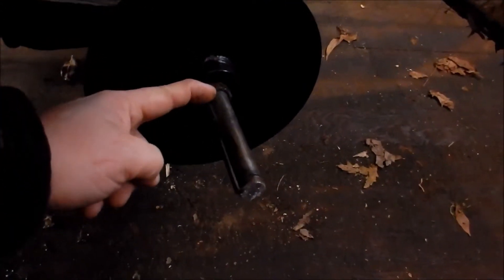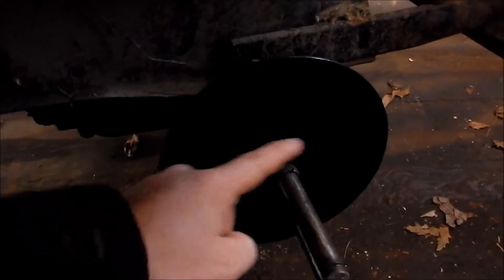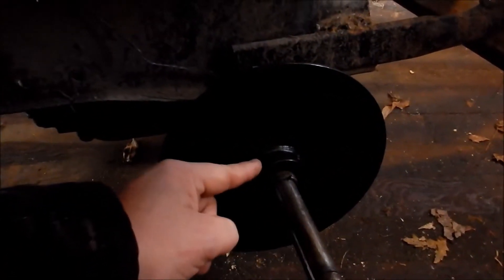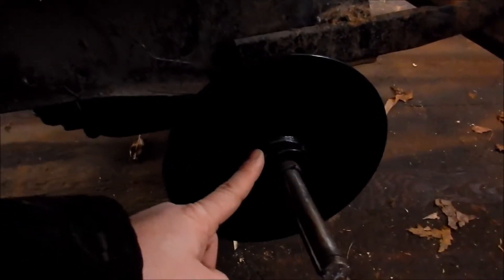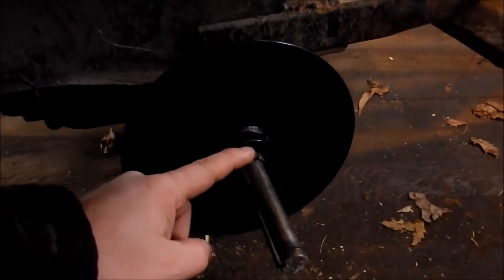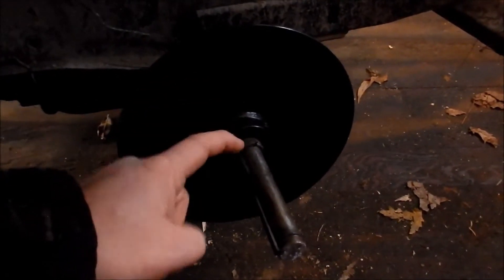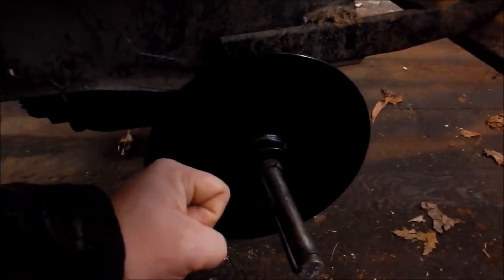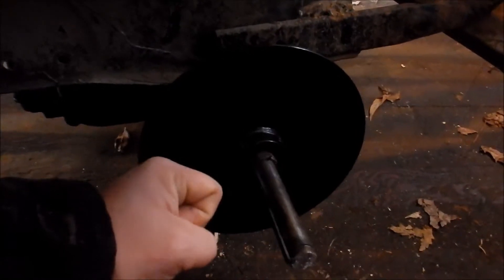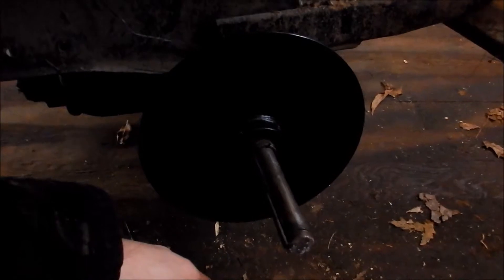This is a self-adjusting rotor — there are two Allen screws up here that you tighten, and you run it once and it adjusts itself. I'm going to put maybe four tacks in the rotor itself to the metal sleeve, just so when the caliper grabs it, it stays and stops me. I'll be doing anywhere from 45 to 55 miles an hour on dirt on this thing.